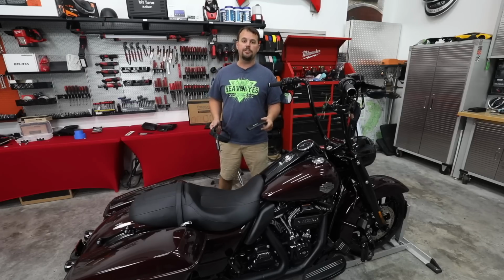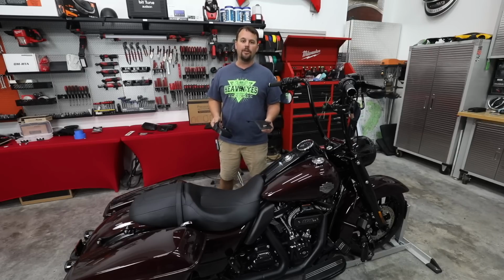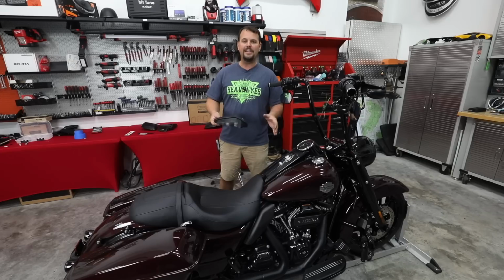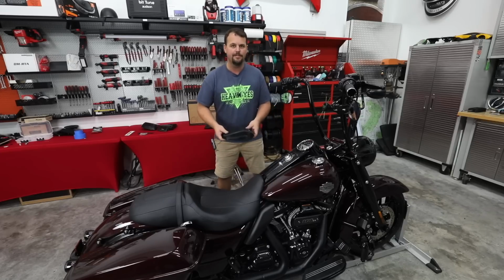I'm making a short video showing you step-by-step how to use Precision Power's HD14 SBS. Now that's Harley-Davidson 14 and newer Saddlebag speaker install kit. So what we're going to show you is how to use their template to cut your lids and add a grill and a lower portion to do what's called a cut kit to add 6x9s to your existing bag. No painting necessary. Now watch the process as I show you exactly how to put this in.